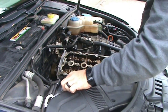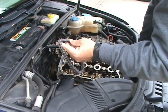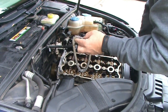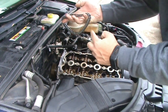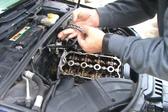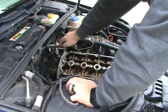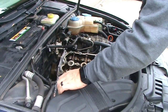have the timing set correctly, which is to do it correctly. I've looked up, and even with the plate, people get a tooth off a lot of times, and to avoid that, people are saying, oh, from this gold link over, you need 17 to 18 links, which I've marked here. And then that goes over the timing mark that's on your intake side. That way, when I put it back together,